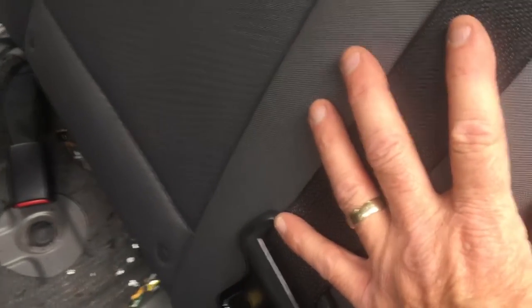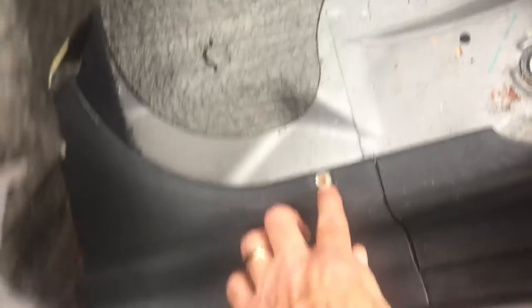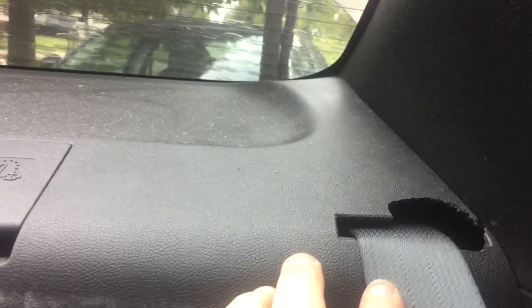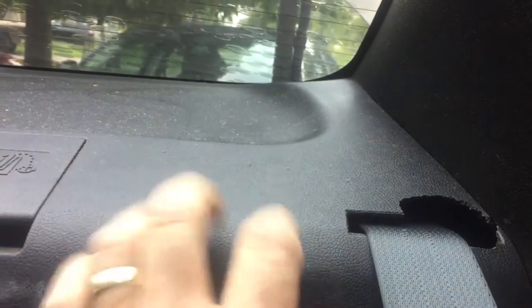Another reason we had to take it out is that we may have to remove further these side panels as well as the backs of the seats. The backs of the seats don't look too difficult. The side panel trim — the screw will have to come out here because this piece is slid underneath that one. That might give us enough movement to slide this one out from underneath. Once we get the back of the seat out we'll see what sort of clips or screws might be on it. It's underneath the weather stripping just a little bit — I think it'll just slide out from under the weather stripping. We may also need to remove this back plastic piece to get into where the recoil mechanism is for the seat belt.